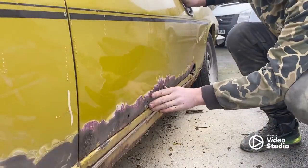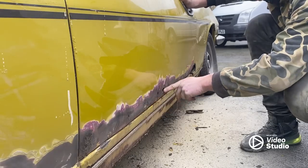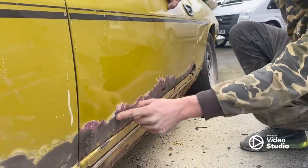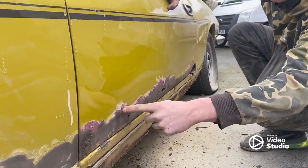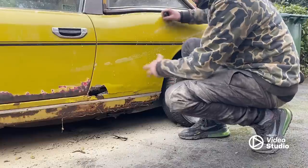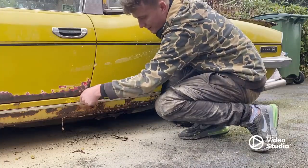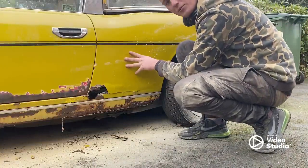Here's another panel that again isn't too bad — the rust is barely coming up here. I think I could even probably make the repair myself by just chopping it off and joggling the edge in. Looking at this door, it definitely isn't original to the car. You can see some of the old paint coming through — it's obviously come off another car, and you can see a magenta colour underneath. I'm not going to bother bare-metalling the sill because I'm just going to change the full panel anyway — the outer skin is quite scabby at the top. Moving on to the back.